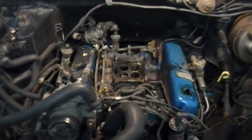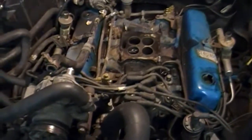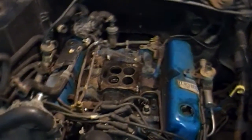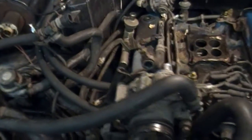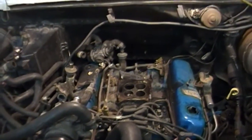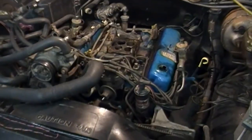And we'll pull the spark plug wires. I'm thinking I'll just leave the distributor right there. I should be able to pull the manifold off without pulling that off. I might have to pull the smog pump. I don't think I will though. Might be kind of tight though. But yeah, it's the second cylinder back on this side that has the leak, and so I'm just gonna do both cylinder heads and everything, the whole assortment. But yeah, we'll keep you updated.